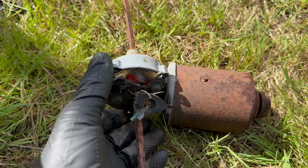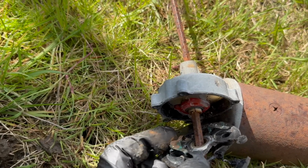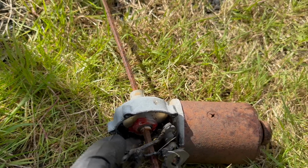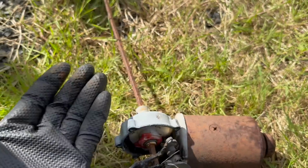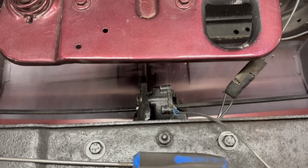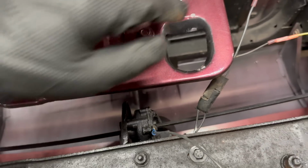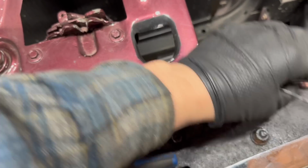I do have a super horrible ruined motor here we can look in to get an idea of what it's like. There are two sets of points in here, controlled by these little spinning plastic wheelie bobs. Those are actuated by the motor's mechanism at various points in its rotation, such that it's energized to open in one direction and then energized to close in the other. Unlike the earlier system on the '66 and '67 that required 4 switches, 3 relays, 2 motors, and a whole bunch of wires, it takes exactly 2 power wires and 1 ground wire to make this motor work.